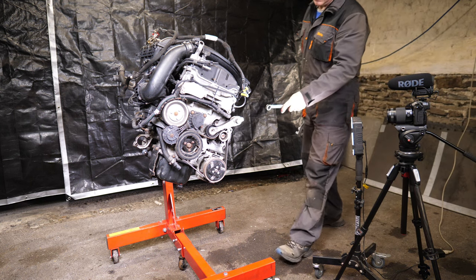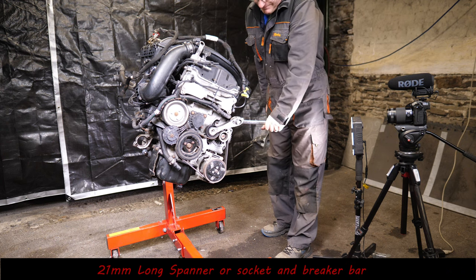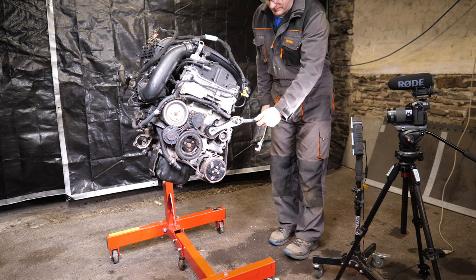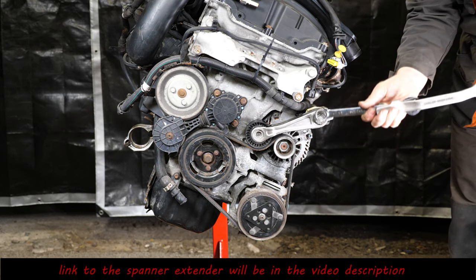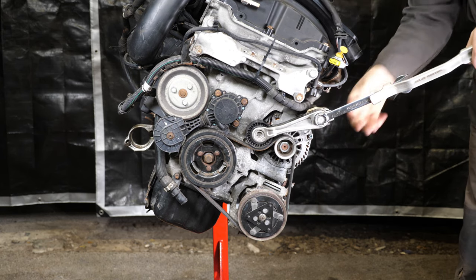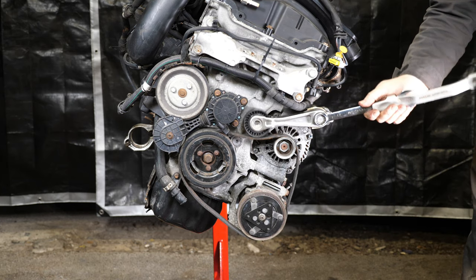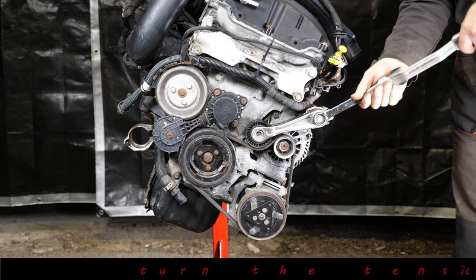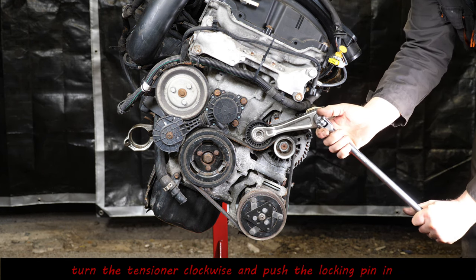So it's a 21mm spanner to take the tension off the belt. Now that was quite stiff for me, so you may want an extension on a spanner, because obviously the access may be quite tight. I'll leave a link to that extension tool in the description. But since the engine's out, I'm going to resort to a 21mm socket on a breaker bar. It's just a bit easier.